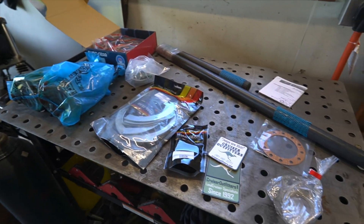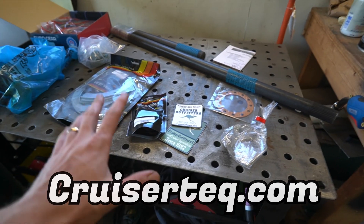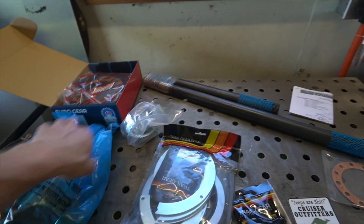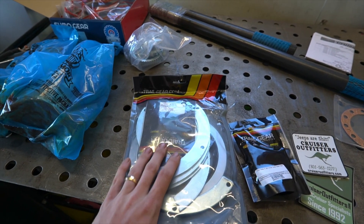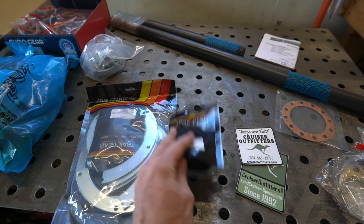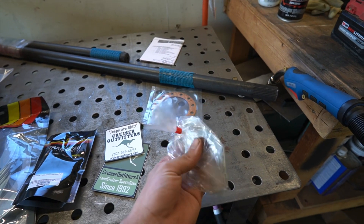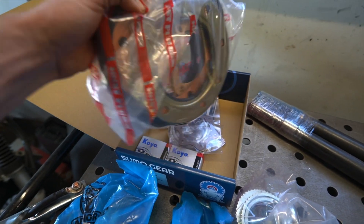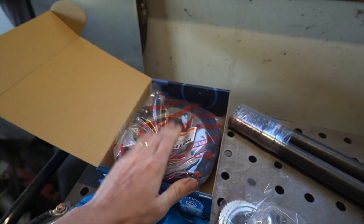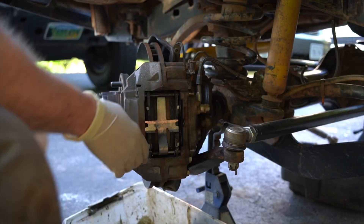Taking a look at some of the parts we got for the rebuild — from Cruiser Outfitters, thank you for the fast shipping. I am not sponsored by them at all, they are just awesome. We got some chromoly birfields from Trail Gear, new axles, a Trail Gear Trail Safe wiper set for the rear — upgraded over factory instead of that weird felt seal — and some upgraded inner axle seals for the front. We also have new seals for the rear, shims for the king bearings on the knuckle, and a standard knuckle rebuild kit with new bearings and seals. The felt gasket in the kit we aren't going to use, but it was convenient to buy the full kit. Let's head out to the truck and get started.